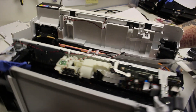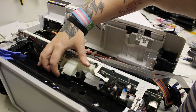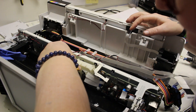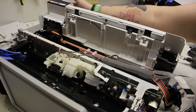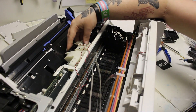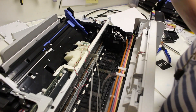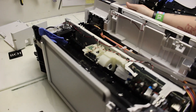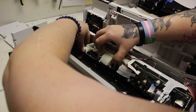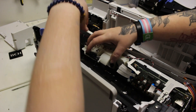There are tabs that will line back up into the main rail, and there's going to be a hole on the side of this PSD assembly where the LD shaft will fit in. There's a spring holding a finger with a roller at the end that goes through the back paper feed hopper. I'm testing that spring to make sure it moves, and pushing the PSD assembly over to the right side of the printer to make sure it's fully on that roller.